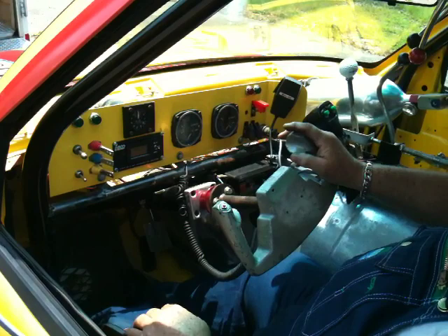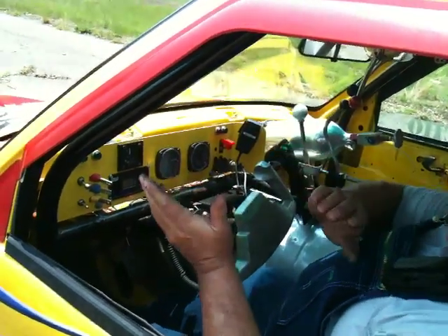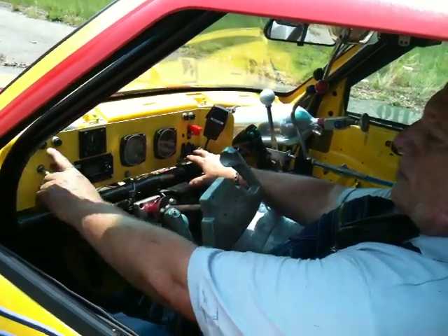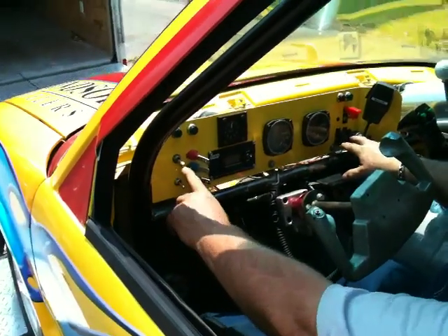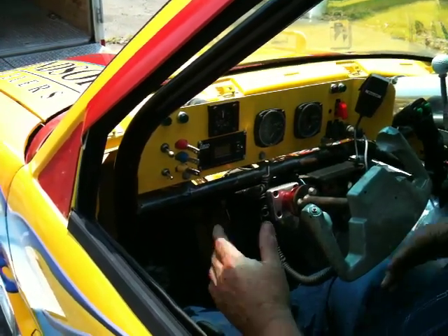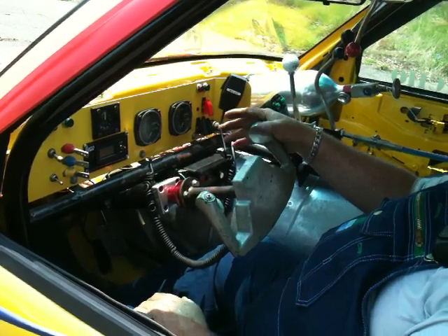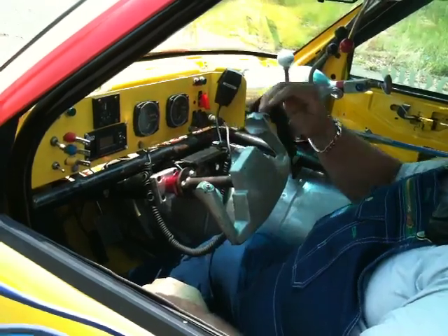With everything turned on, when you flip this switch up, your starter will start spinning over and come up to speed. You leave it on until you're finished with the run, then just raise your foot. You can drive it back to the pits. In your shutdown mode, turn off the two afterburner switches, turn off your main fuel supply, your power, turn off the pump and the starter, and you're down. We always clear the engine out after it's gotten hot — if it has a little extra fuel, you might get some smoking. Just bring the starter back up and it'll clear right out.